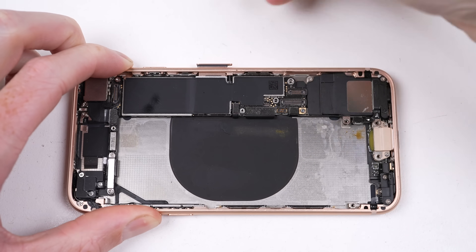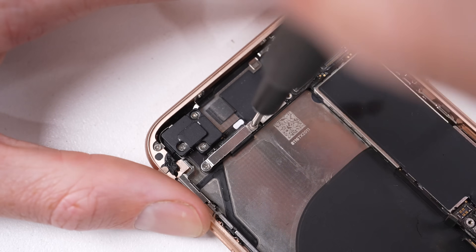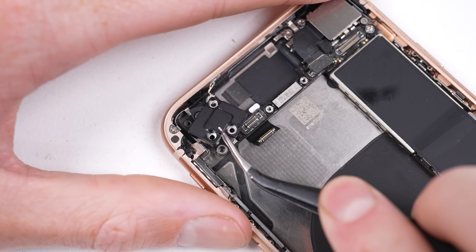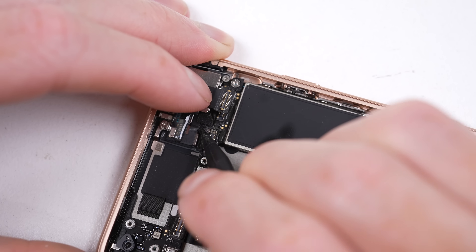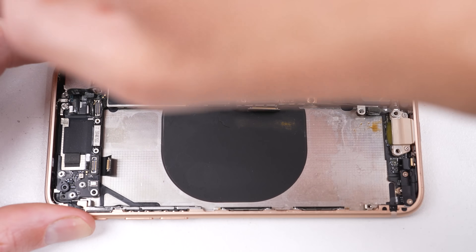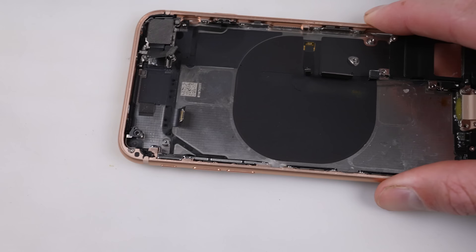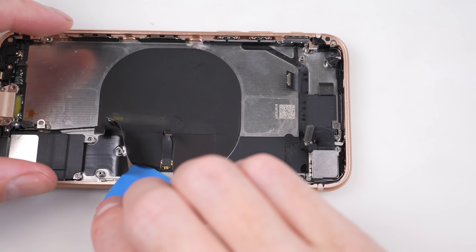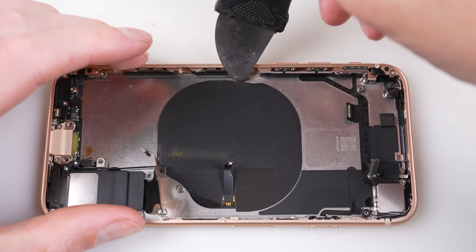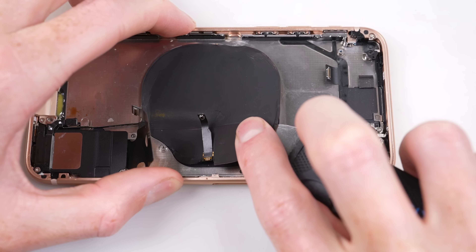About 75% of the wireless charging coil is now visible, but we still can't modify it with the logic board in our way, so that's next to come out. There is one hidden Phillips screw beside the camera connector to look out for when unfastening the logic board. With all the cables and screws removed, the board can be pulled free. Now it's over to the heat plate, where I can heat up the back of the phone to aid the removal of the wireless charging coil. I'll need to use a thin metal tool to jimmy my way under the edge without causing any damage. Once you have an edge started, it's easy to work up the remainder of the perimeter. However, there is some adhesive in the centre, so using some alcohol will help soften it enough so that the coil can be lifted free.